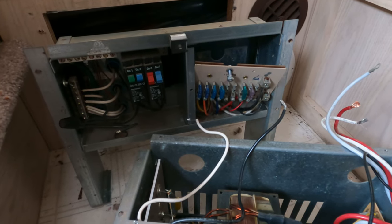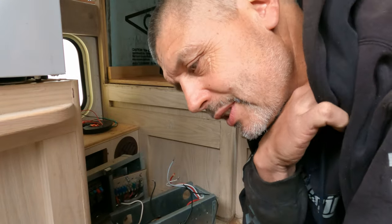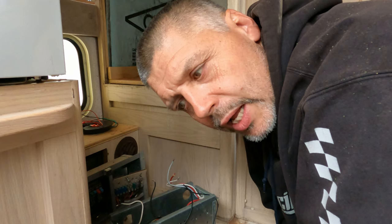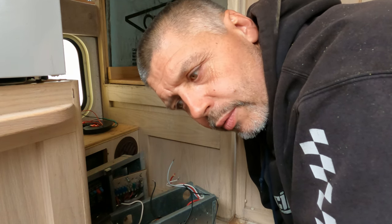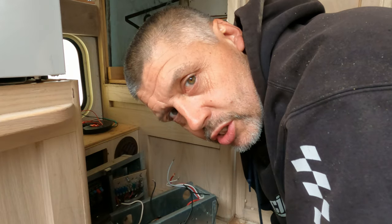Since our converter is going to basically be a charger charging the batteries, we're just going to have battery power coming up to here. Since we have a 45 amp charger, I'm better off running two gauge wire back to the batteries from here, or just putting the charger back by the batteries so I can hook it right to the batteries. Then I can run AC back there to plug the charger in — that's a lot easier than running heavy gauge wire. I just need to make sure I have a good power feed from the batteries up to this panel and the fridge.